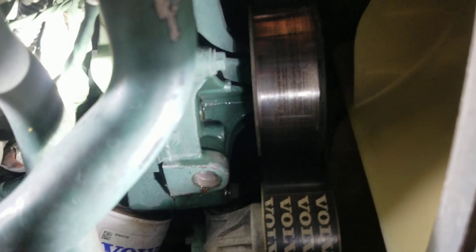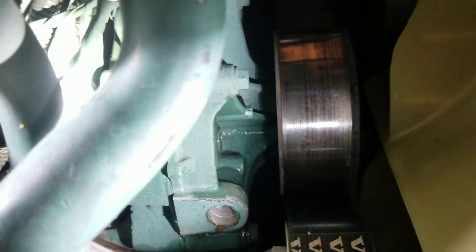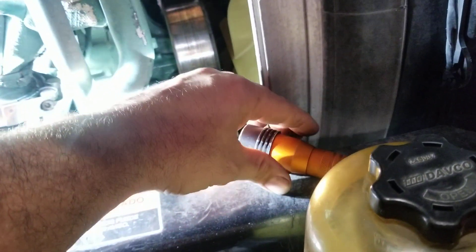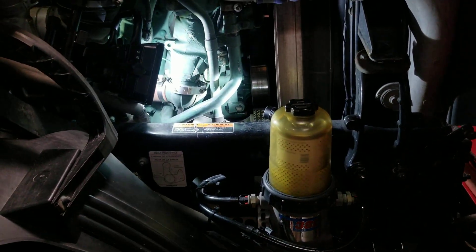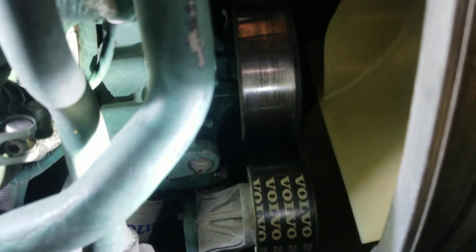You can see the belt pulley and water pump here. Zooming out, it's located on the passenger side, front right corner of the engine. To take it off, I start by cracking loose the bolts on the pulley — the inner front bolts are 10 millimeter.